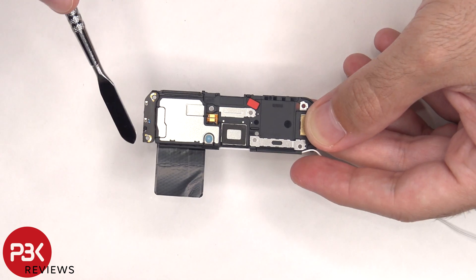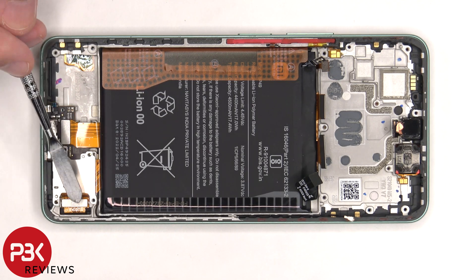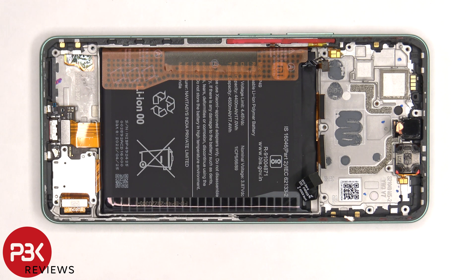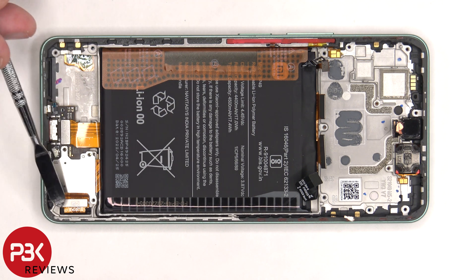The white coaxial cable connects to an antenna board on the side of the speaker. Once the speaker assembly is removed, we can see this flex cable for the screen which is connected to another flex cable that goes for the SIM reader, and that flex cable connects to the main board. So if you needed to replace the screen, you'd have to remove the back plate, remove the screws on the top and bottom covers, then lift up and remove the top cover, disconnect the battery cables and the white coaxial cable, and then remove the bottom speaker assembly, giving you access to the screen cable.